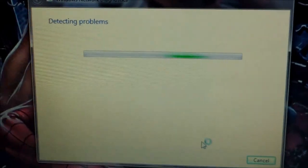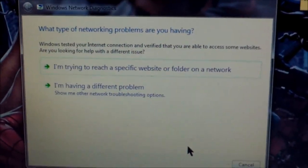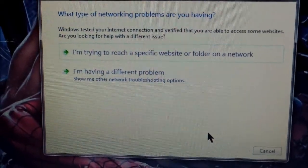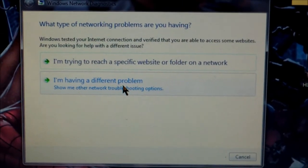Here's how you reset your network. On your wireless signal, there are wireless bars on the bottom right. You're going to right-click it and then click on Troubleshoot. When you click on Troubleshoot, it's going to detect the problem and hopefully reset your Wi-Fi. It's also recommended to first reset your wireless router and your modem — your cable modem or whatever modem you have. From this point on, you just follow the instructions and it should reset your wireless.